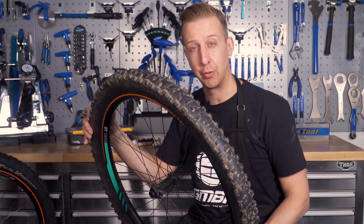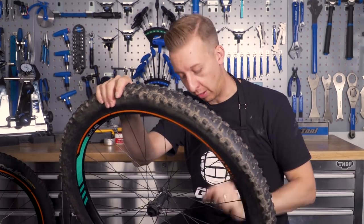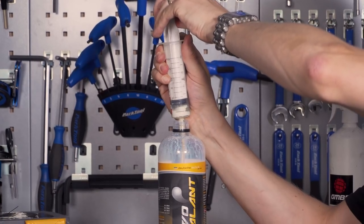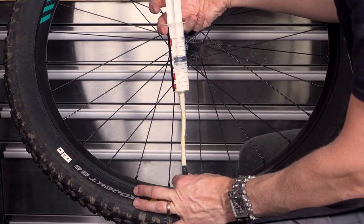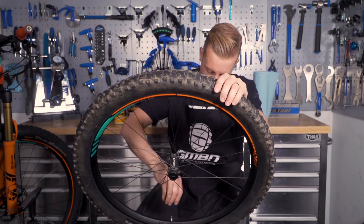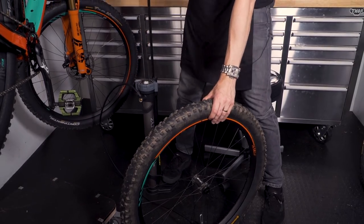Whilst you have the valve core out of your bike for cleaning, give the wheel a little shake. On this particular one, I can't hear any sealant inside, which suggests the sealant has actually dried up. So I'm going to take the opportunity of the valve core not being there and put some fresh sealant in through that empty valve. The best way to do that is with a basic syringe — there are various ones available on the market. You simply suck up some sealant and pull it straight in. I can't recommend using a syringe for putting fresh sealant in enough, because it means you don't have to reseat your tires again. Everything will be perfect as soon as you re-inflate, and you won't need to use a compressor. My valve core is nice and clean, I've got some fresh sealant in there — it's just a case of putting some fresh air in.